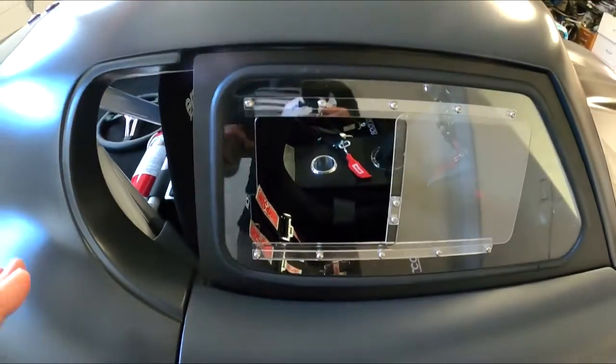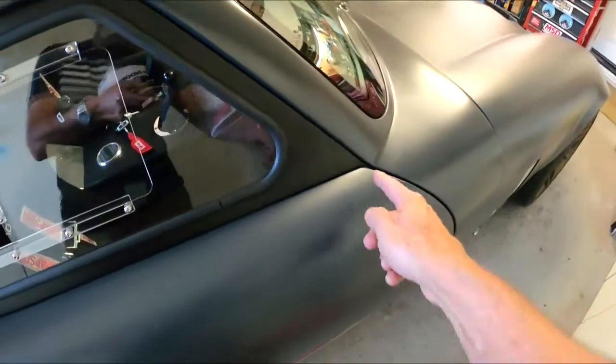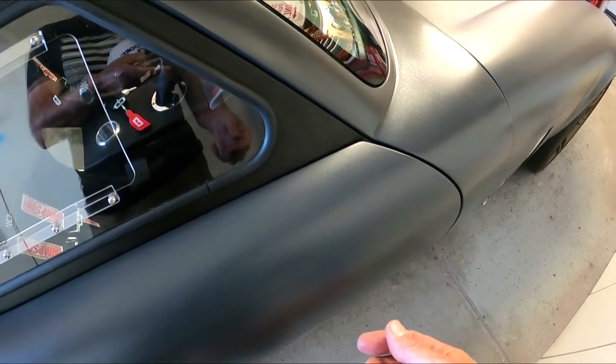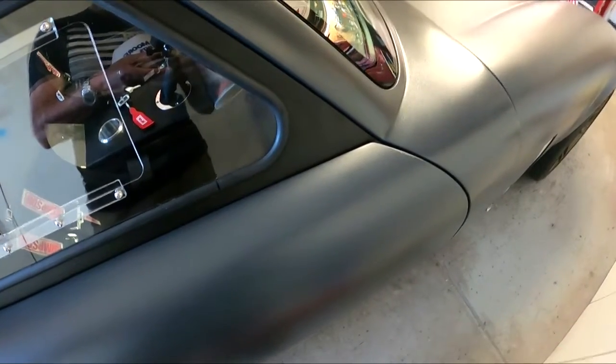So I lifted the window inside. I'll show you the screws I adjusted here. So as you can see, this I need to come back a little bit. So I can either re-drill that hole. I'll show you once I open the door. But what I think I'm going to do is hog out that hole a little bit, because that way I can use the existing hole.